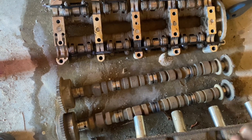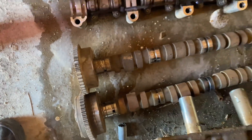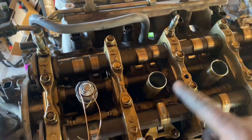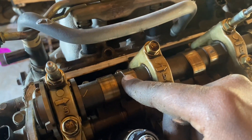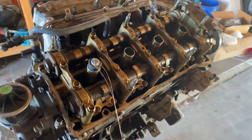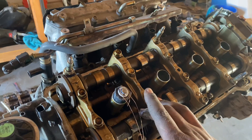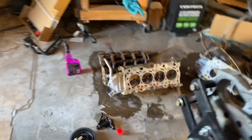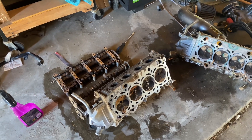The exhaust side has three lobes — that's how you know you have true VTEC, like the B-series side of it. Basically, when you hit certain RPM like 5,500 RPM, your cam rotation will be on the bigger lobe instead of the two outer ones — that's what true VTEC is, the main lobe transfer. The 'i' part for the non-traditional VTEC is the economical side — it just stays on one exhaust, and when VTEC kicks in around 2,200 RPM, instead of having 12 valves it goes to 16 valves.